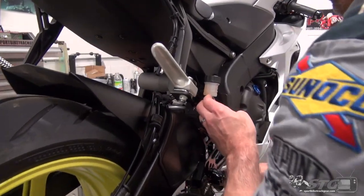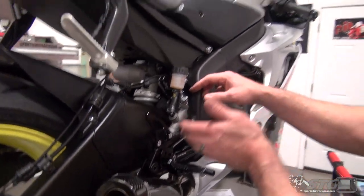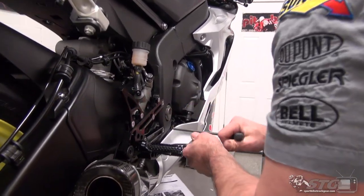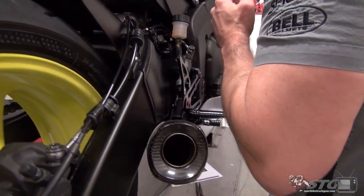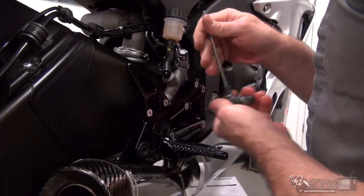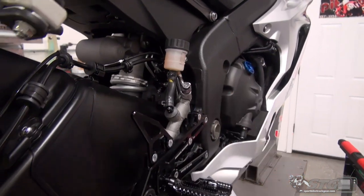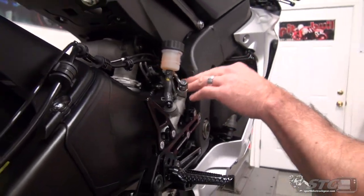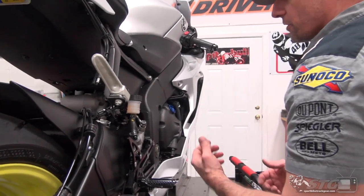I made my little adjustment there. Pedal feels great, everything's okay — I've got no spill, no drip. If you want to bleed your brakes after making that move, that's a personal choice, but I feel like in this situation I am good to go. Now go ahead and torque down the mounting bolts — torque specs are included with this kit. If you prefer to use a torque wrench, now is a great time to grab that. Double check the brake master. That brake line is going to be your challenge point — it's going to depend on what brake line kit you've installed on the bike. With OE brake hoses that would probably be a lot easier since they're more flexible than a stainless steel braided brake line.